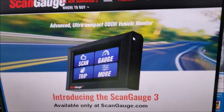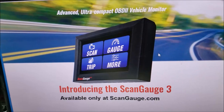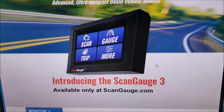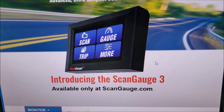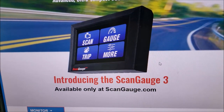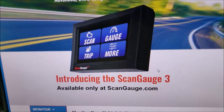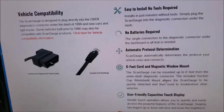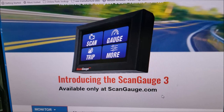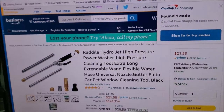We need a digital readout for true temperature. This ScanGauge is something kind of new — I've been playing with it for a couple months and have a more detailed video coming. If you own a Workhorse, this is a must-have tool. You get engine temperature, transmission temperature, and programmable alarms. For example, if you drop a heater hose and start to overheat, the alarm goes off before you damage your engine — I've got mine set at 220 degrees. You can update it over Wi-Fi and it monitors torque, voltage, and much more.